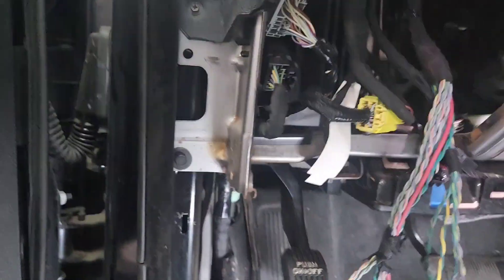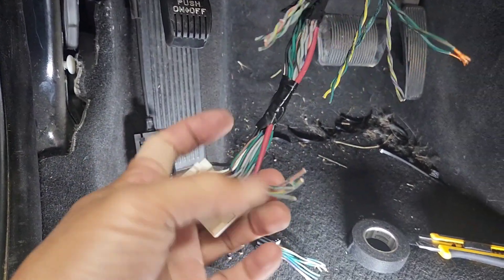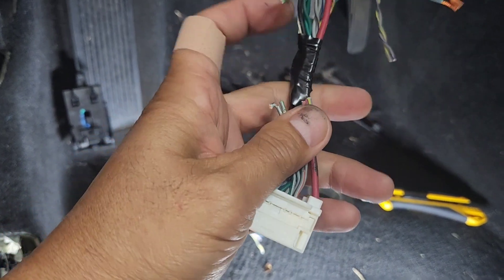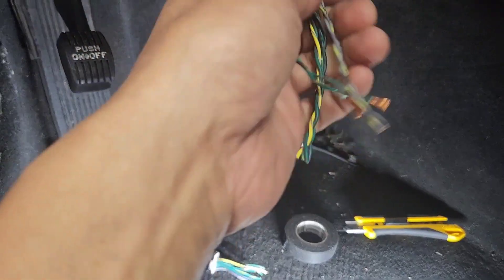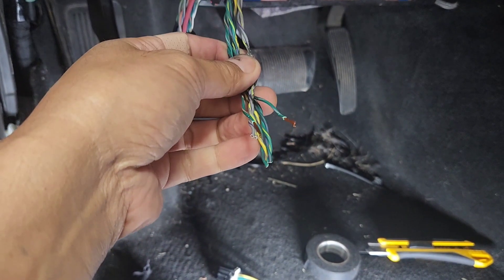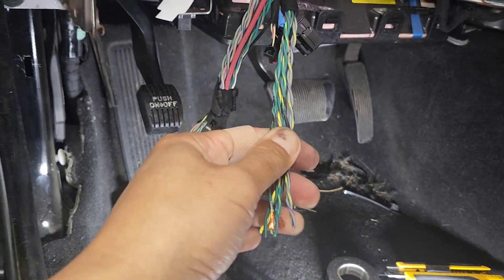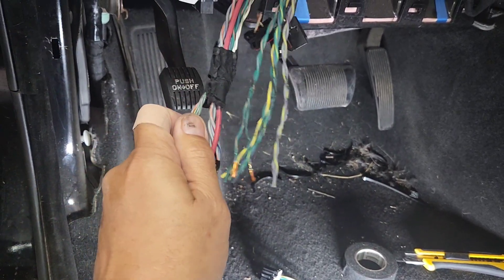As you can see, he's already cut some of the wires. I think this wire here is for the tweeter — he cut it pretty short, not sure why. I'm gonna tape it back. This wire goes to the four six-by-nine speakers — two front and two rear. I'm gonna run a nine-wire conductor; I'll share a link where you can get it from Amazon or eBay for about $15. I'll plug the tweeter wire back in so he can get his tweeter signal from the factory amplifier.